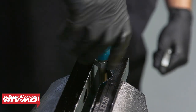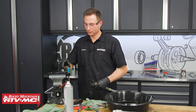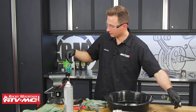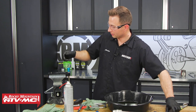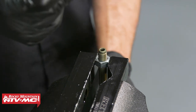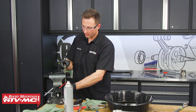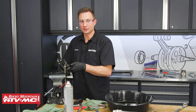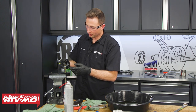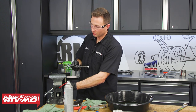This one did come loose, but if it doesn't break loose you might have to use a torch quickly on it — just make sure you don't have any oil or contact cleaner on it when you do that. We will be reusing this piece as well as this nut. To get this nut back, I'm going to lightly clamp this rod just to make sure we don't damage it, so that if we decide we want to run the air fork again at some future point we can.